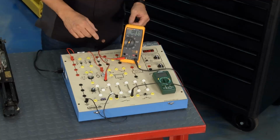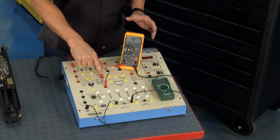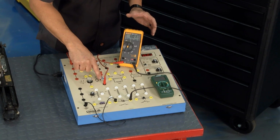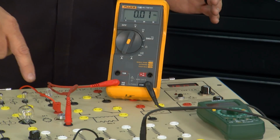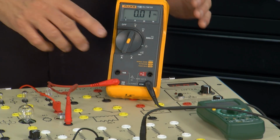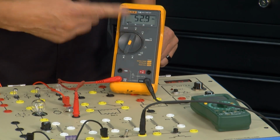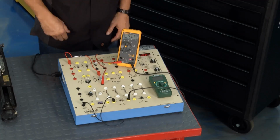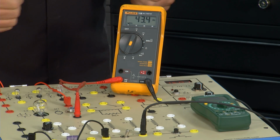You can actually see it right here. So what I do, I have the meter here. My power supply is coming in. It's going through this motor right here, and then I'm completing the side over here to ground with the meter. So the amps have to run through the meter. He's going to count them, and then we're going to understand what's going on. So I'm going to fire up that motor. You could see it spinning. That's wonderful. 4 amps, 4.5 amps, whatever it may be. That's actually milliamps, so 43 milliamps.